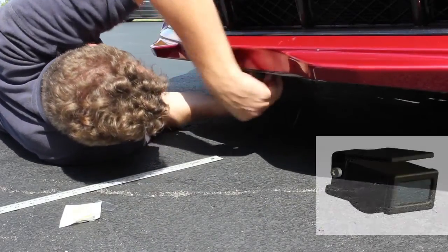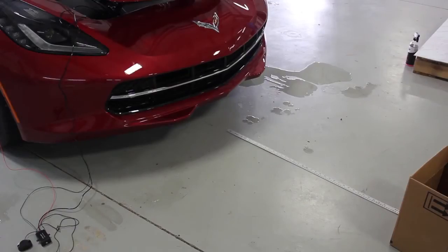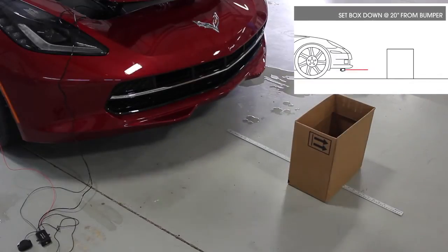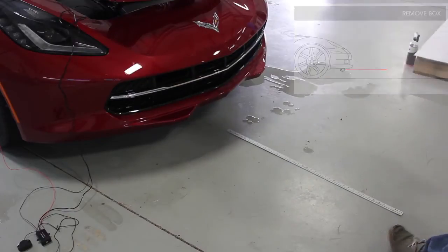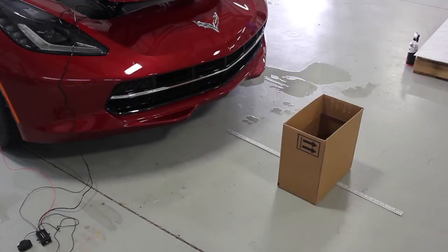For distance calibration, place a tape measure or yardstick on the ground in line with the center of the Stingray. Place a medium-sized box at the 20 inch mark from the nose of the car. Once the box is in place, press the calibrate button on the control box — you should hear two quick beeps indicating new calibration values are accepted, then a constant tone indicating the sensor detects a barrier. Remove the box and test the alert distance. You can experiment with the warning distance, but we recommend this 20 inch setup.